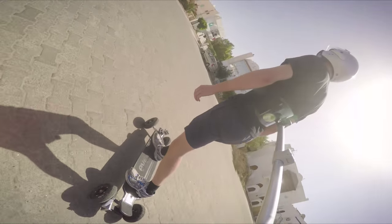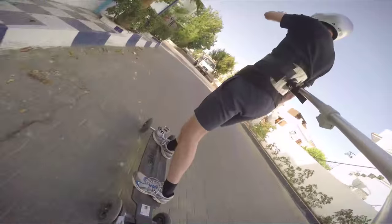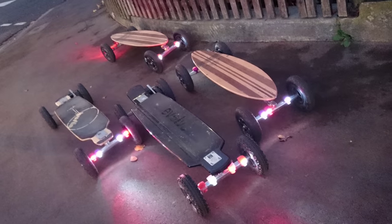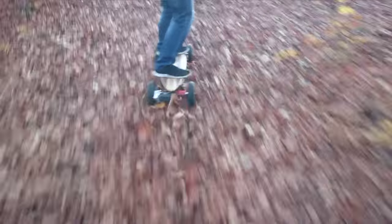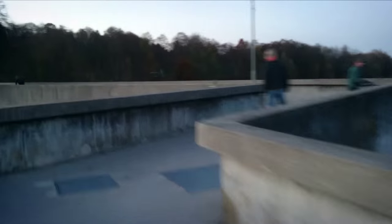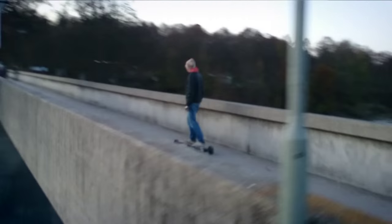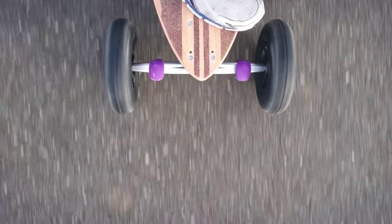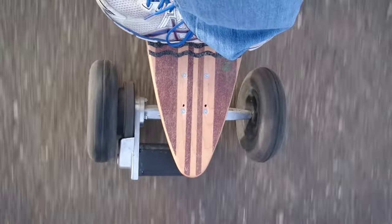Now let's talk about board performance. I really love the board and at least for my rider weight its performance is great for most terrains and virtually everything I use it for — two thumbs up for Evolve. From time to time I get to ride my buddy's bamboo and pintails, and compared to the carbon they feel less stable at higher speeds and especially off-road, but their turning radius is significantly better. Common to all these boards are occasional cutouts, meaning the remote suddenly and briefly disconnects, causing thrust fluctuations — that's a bit annoying and there seem to be a number of influencing factors.